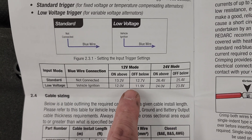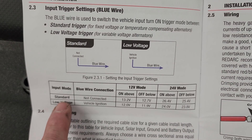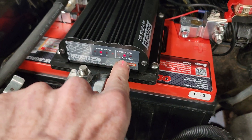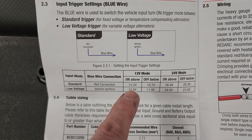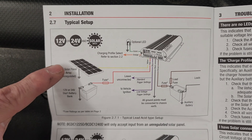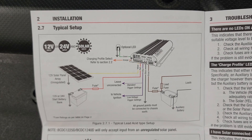If you connect the blue wire to vehicle ignition, it only charges when above 12V and the ignition is on, and stops below 11.9V. Even though I have a relatively variable alternator, I went without the ignition trigger because I have a wall charger at the house I keep connected. I already tested it — if the starter battery is above 13.2V it stays charging whether the ignition's on or not, so my alternator reliably puts out over 13.2V. That's how the blue wire works. Here's the wiring schematic provided by RedArc: 12V, solar panel if you have it, starter battery, second battery, ground, and the RedArc charger. Pause the video if you'd like to study it.